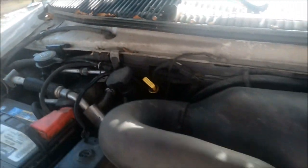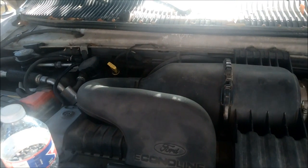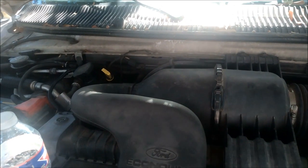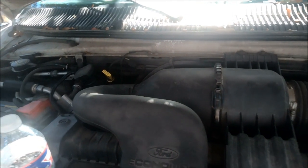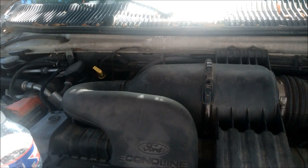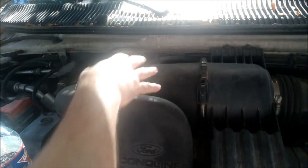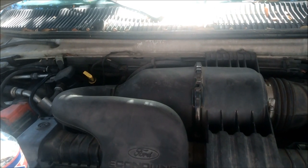When you go to Max AC, it sucks recirc under the floor by your feet. Now Max AC works better because sometimes that door flap in there gets old and doesn't completely seal off, so you're still getting a little heat from this area or this area. So even Max AC works better now.